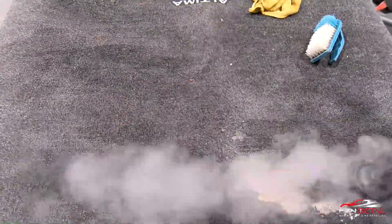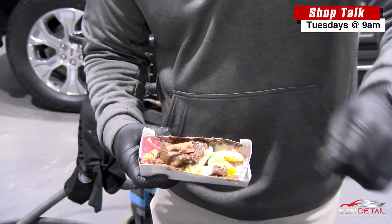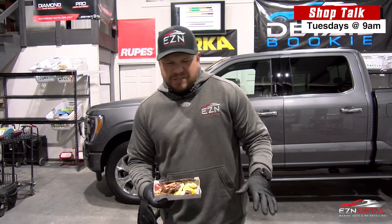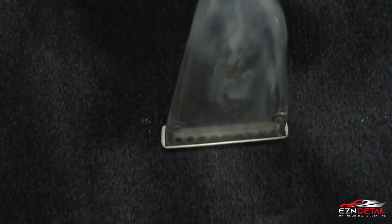As you can see, there was a ton of candy in that carpet and we got the bulk of it out. We used the solvent and a plastic razor to scrape some of it out — on the ceramic side it sure came out a lot easier. But there's still some sugar and dye left in this carpet, so it's time to break our extractor out, use some heated water, and really suck all that stuff out and get this carpet back to new.